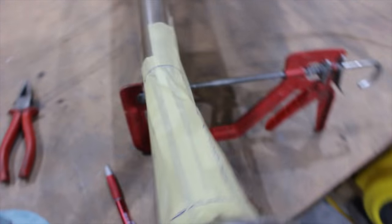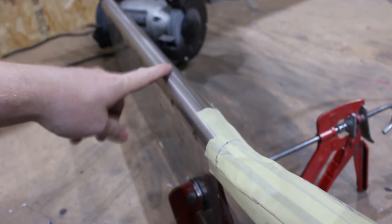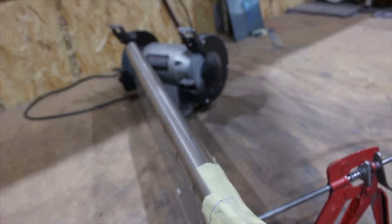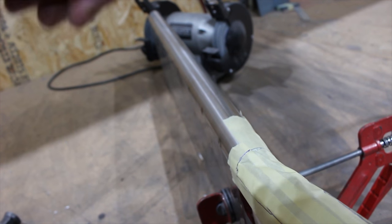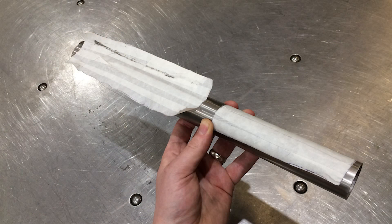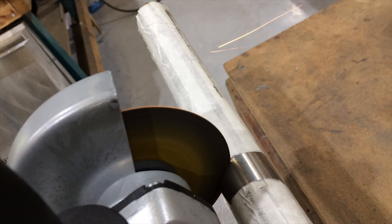That's drawn around the hole, and now I can peel that off. I'm going to stick that around the tube that I made this piece from, and that'll allow me to open it up a bit and hammer it out to get the flare so that it meets this round tube up here. Using the templates, I've then stuck it around the tube, angle ground it a little bit on the waist side, then hammered it out to get it to shape.